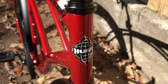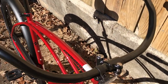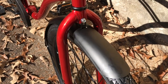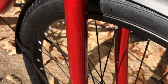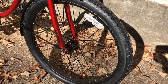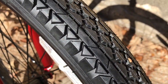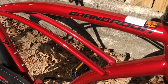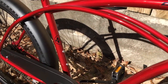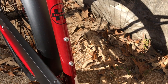The Cranbrook is a standard beach cruiser, so there are not really any surprises. You have the standard sweeping handlebars with Huffy grips, a quill stem — everything you would expect for a $79 beach cruiser. The fenders are metal and they mount to the front fork, which is branded with a Huffy logo. The tires are generic black 26x2.1 with a nice street tread on them. The frame itself only says Cranbrook, with a beautiful gloss finish accented perfectly with matte black on the fenders. The seat tube features bottle cage mounts and Huffy branding.